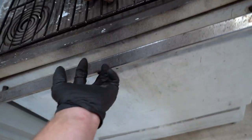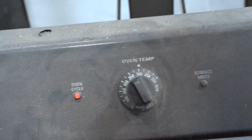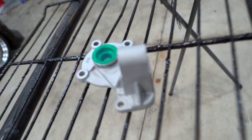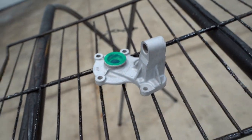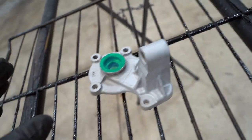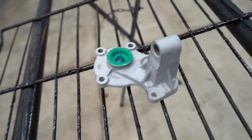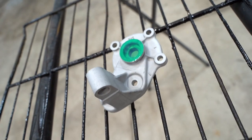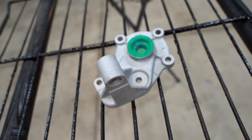We're gonna give this thing 60 minutes at 300 degrees, and then we can pull it out and get that Cerakote sprayed. Our tester piece is all baked out, gassed out, ready to go. As long as there's no oil residue you see seeping out of places, you should be ready to go ahead and spray the Cerakote as soon as it's cooled down. And I don't see anything going on, so let's let that guy cool down for probably 20 minutes.